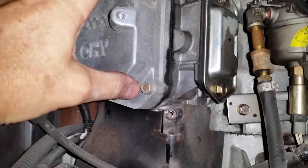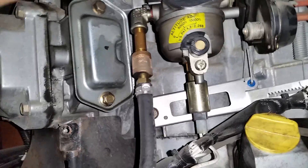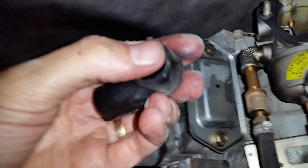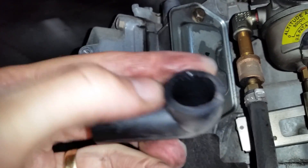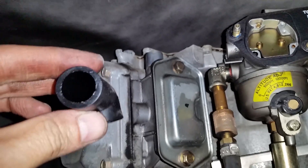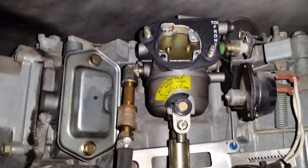Here's my other valve cover — 10 millimeter screws. I'll take those off and check this clearance. I'm also looking around checking things out, making sure these rubbers look good and aren't cracked. That one is cracked a little bit and getting worse — that's your PCV valve that runs the oil vapors back through the air box and through the carburetor. I'll order a replacement, and new gaskets, and I'll put in new spark plugs while I'm at it.